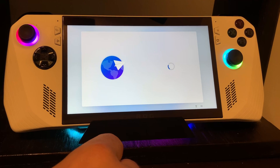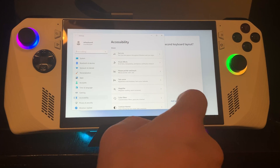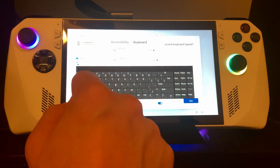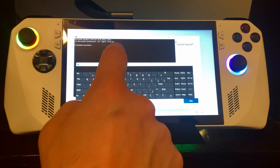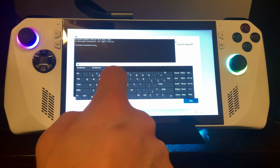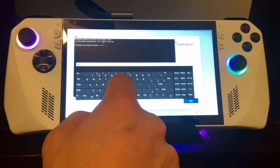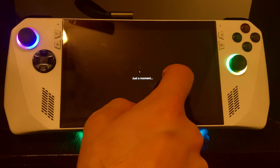To shut it down gracefully, first choose your location and then select your keyboard layout. Once that's selected, use the accessibility menu — which looks like an outline of a person on the bottom right — and toggle the keyboard. If the keyboard doesn't come up and instead the accessibility menu appears, scroll down until you see the keyboard option and toggle on the on-screen keyboard. Once that's open, press Shift, then the Function or FN key, then F10 to open a command prompt window. Tap on the command prompt window so it's focused, then type: shutdown -s -t 1 -f and press Enter. If entered correctly, the Ally should completely shut down.